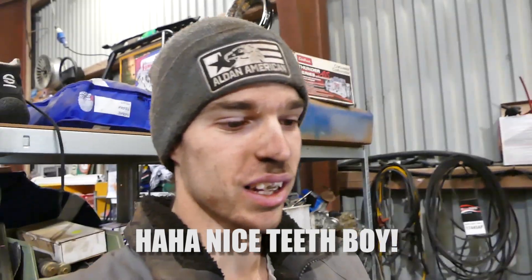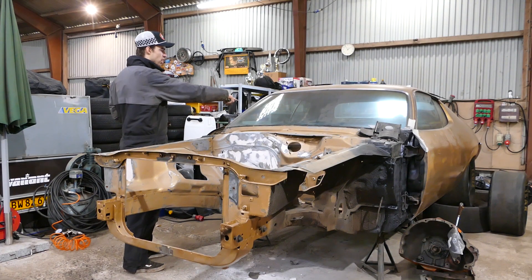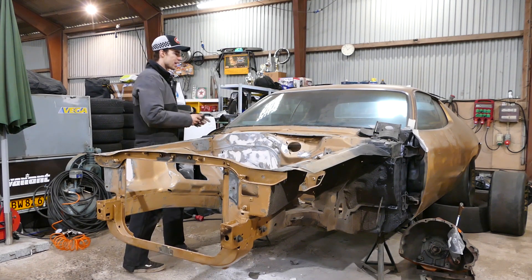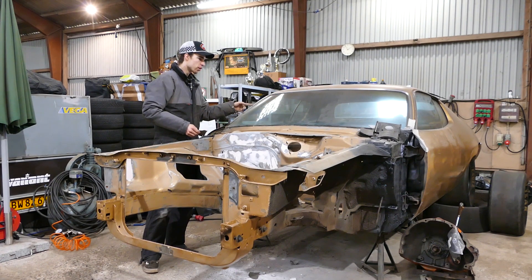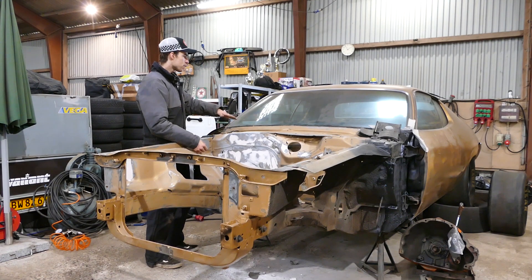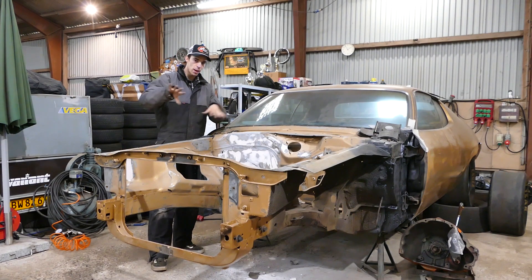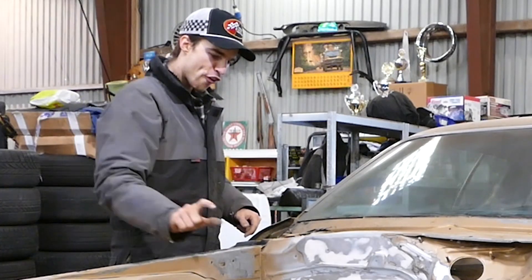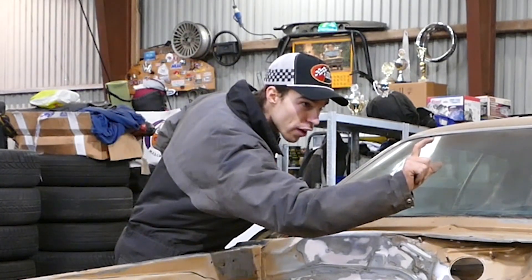I don't know why. Now I'm gonna move back to the trunk, which I have a giant heater inside. I closed all the doors and the trunk, so it's a nice 70 degrees in here right now — 75, 80 probably. It's a pretty powerful heater. I'm gonna turn that off so there's no wind, open the trunk and utilize that all the panels are still nice and warm. I put the paint in there and I'm gonna paint the trunk.